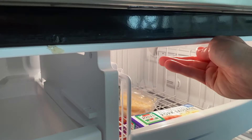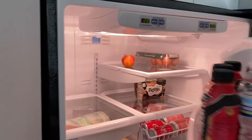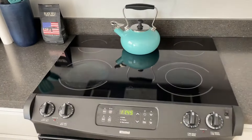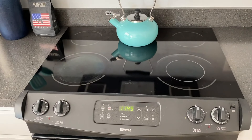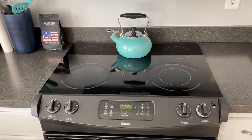Come back down below to your freezer. Do the one, two, three on the switch, and hopefully you will hear that sound. We just did that just a few minutes ago and got it back up and running. So what we'll do is monitor the temperatures. Again, the freezer is 28. Go and make sure everything's shut. It's 11:45 AM — we'll wait about an hour or two and we'll show you the temperature change.